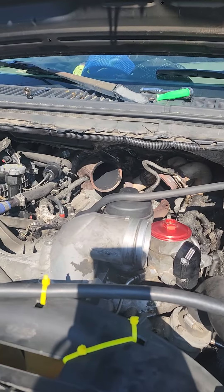We got to make sure that we flood the cavity with oil before we start the truck, that way the bearing doesn't get wiped. I'll be continuing forward and I'll keep making videos as I go.